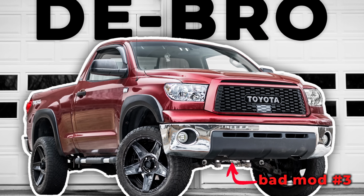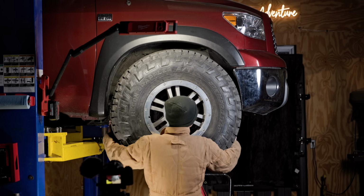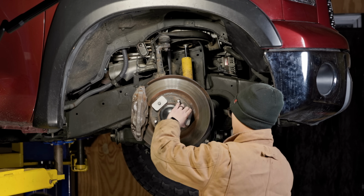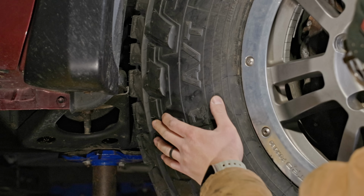If you want to learn more about the mechanical impacts, check out my last video, which I will link in the description below. And back to tire clearance, if I went with the positive 35mm offset, which we can simulate by stacking some spacers, I will have almost zero margin, and a body mount chop will become necessary.